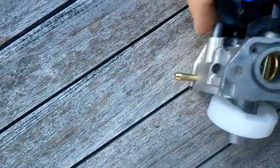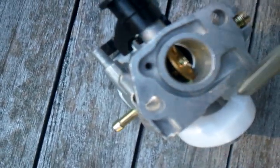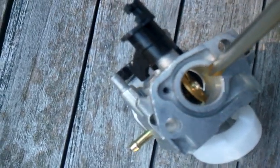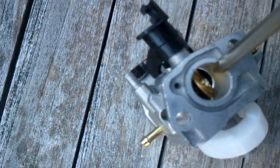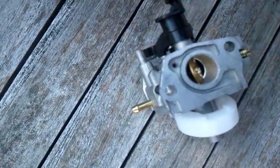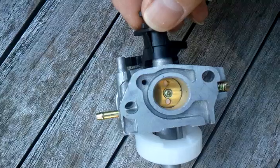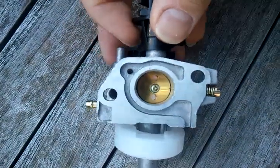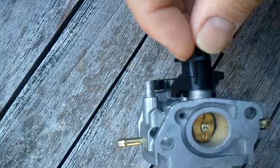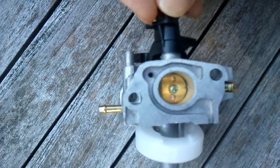So when we flip this over inside, you'll see right down in here — there's actually a place where the needle valve comes out, and then there's also three or four little ports down in there, and that's where the idle jet comes out. You have a standard amount of fuel that comes out for the idle jet, and then you have the amount that comes out because of the needle valve. When I shut the throttle there, there's actually a little cutout — it's the throttle plate reflecting those holes down on the throat of the carburetor.